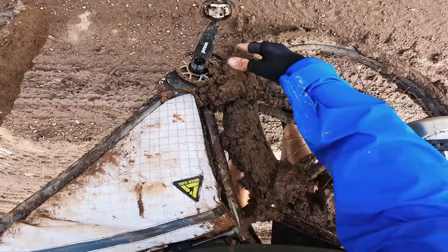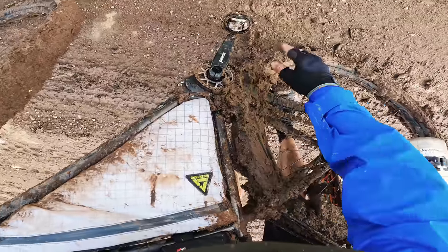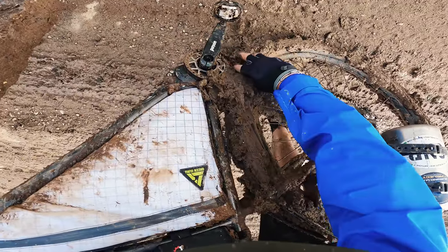Any of these things would have allowed you to continue that last grueling day. In that thick mud, you wouldn't have been out there with your phone trying to figure out how many hertz you have. What I would have done is cranked down and given it a lot more tension. If you had a lot of tension on your gearbox or hub over weeks that would cause trouble, but for a day or two, increasing the tension a turn or two on those tension bolts wouldn't have done any damage, and would have prevented mud from sticking and helped keep the belt on.